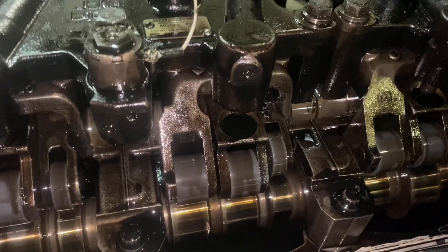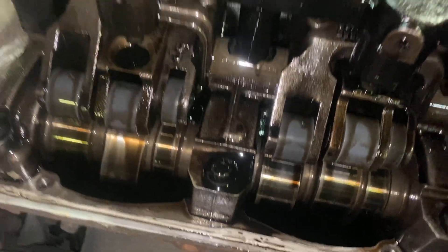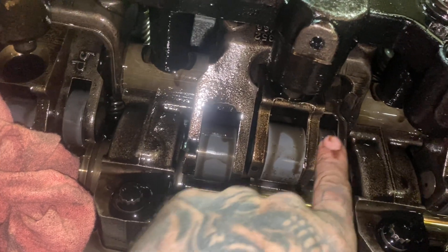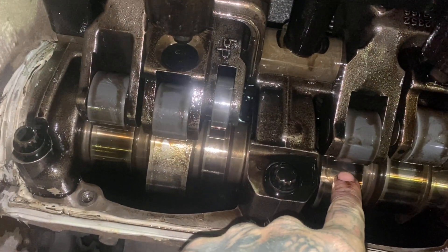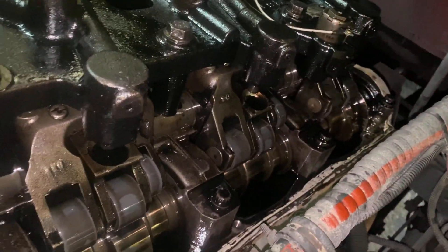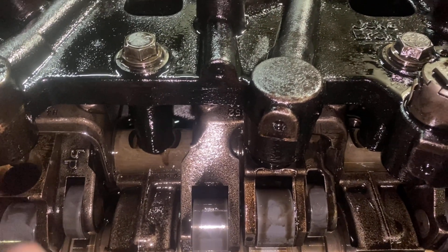Another thing I want to point out — whenever you're doing this, just to make sure, what I usually do when adjusting my valve lash: whenever you've got top dead center and you're rotating everything over, look at your cam lobe. If you look down here at the bottom, you can see it's down at the bottom, so that means this is adjustable right now — and that's the intake side. You'll see how this bridge sets up and controls both valves. This is your injector, this is exhaust — exhaust is opening up right now. You want to rotate that over until it's on the flat spot, where it's not raising the rocker arm up, so when you're adjusting everything you can come over here and check and just make sure you're right all the way around. Whenever you're adjusting the injector, you need an injector height tool. You can also adjust the jake brake as well, but the customer just wanted the rack ran on it, so that's all we did today.